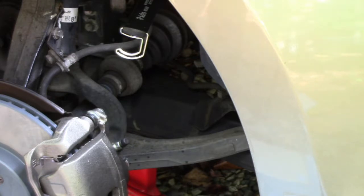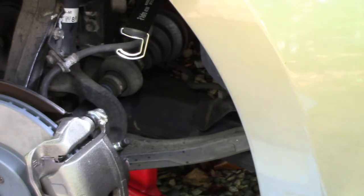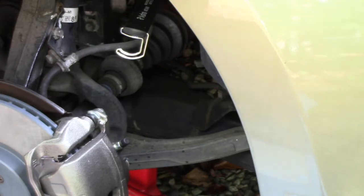Everything's torqued down. I've got my pads in and lubed. I'm going to spray this down one more time with brake clean on both sides to make sure there's no residual brake grease. I use fluid film on all my bolts to prevent corrosion - everything except the banjo. The banjo was in the 26-27 foot-pound range, caliper bolts were 37. I went ahead and bled just that chamber. Don't forget to undo your clamp so you can actually bleed the system. I'll compare it to the other side - I also checked all my boots.